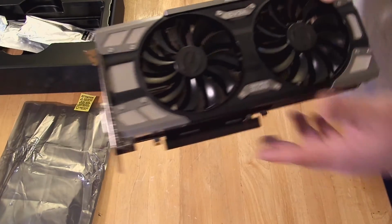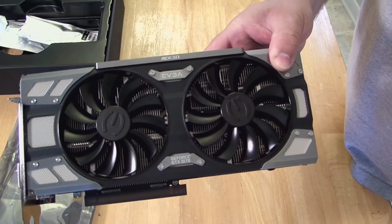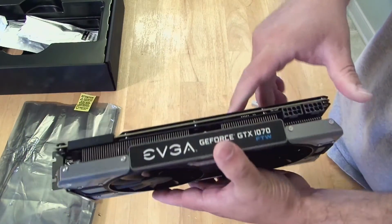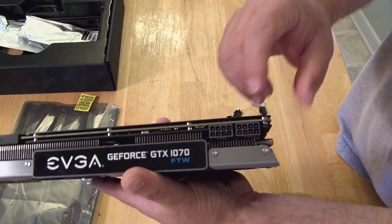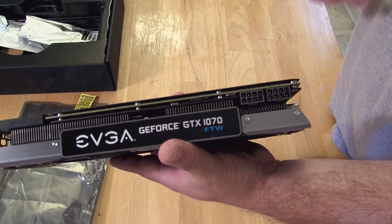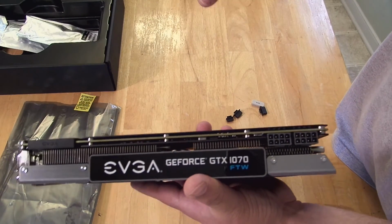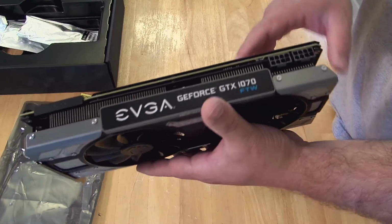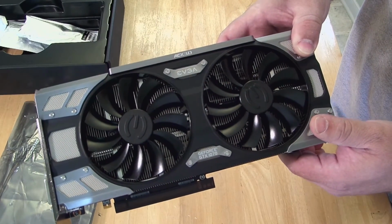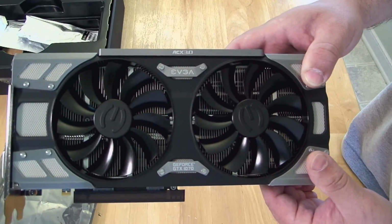Now, you might think this takes maybe an 800 watt power supply or something along those lines, but the power supply requirement for this guy is actually 500 watts with 2 available 8-pin PCI-E adapters, or 2 6+2, or 1 8 and 1 6+2, however you have it configured. Or again, you can use 4 6-pins as I showed you before with the adapters. Now, even though it requires a 500 watt, the total power draw is 215 watts, which is actually pretty low, considering such a big and bad card.